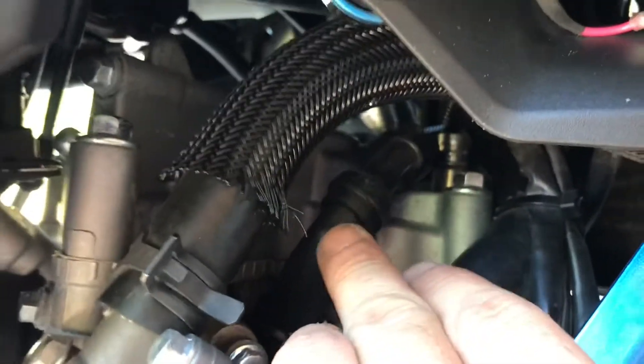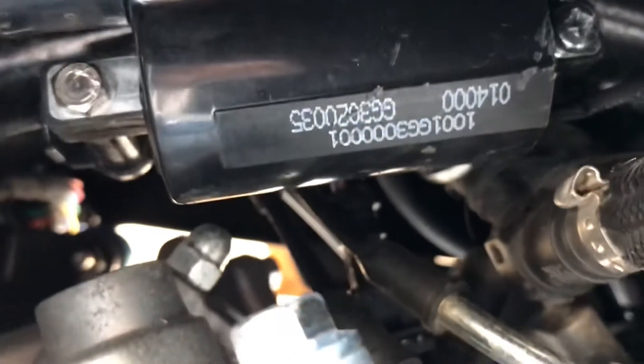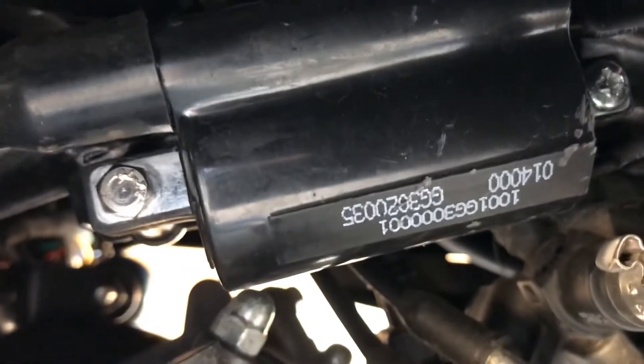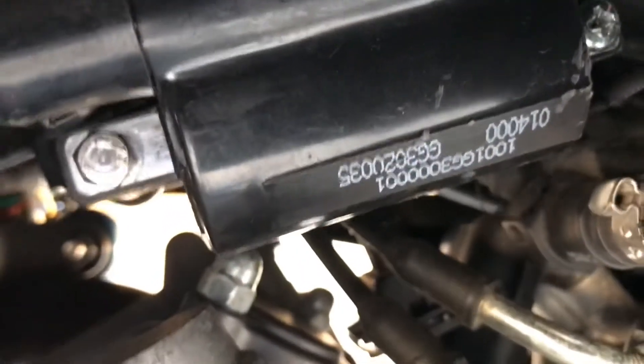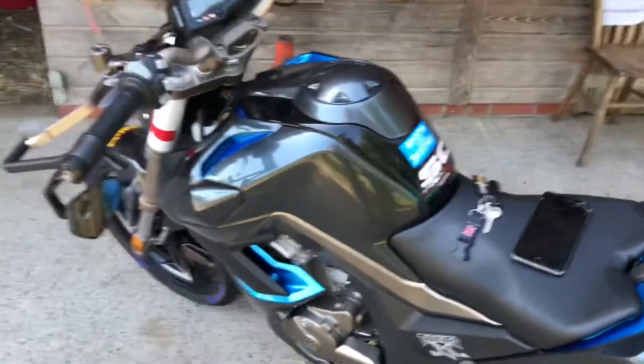When you order it, you get the whole cap, the HT lead, and it comes with a coil pack — you'll see the part number on that. I replaced all that as well. As you can see, that one is a crosshead and that one is now 8mm or 6mm. Basically, when I was getting it off, the bolt rounded because the bolts were a bit of shit. If that happens to you, you've got to drill it out and then just put a new bolt in there. I didn't damage the thread, so I was literally just putting a new bolt in and it was all good.